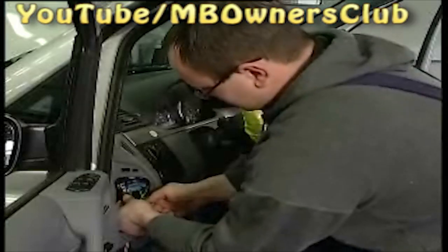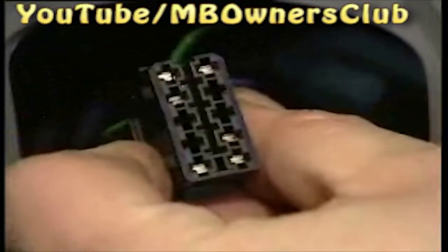In the footwell, connect the cable to the receptor part of the antenna. Next, the green cable is plugged into the switch of the stationary heating, namely in pin number 4. With the new cable, you can contact the switch again from the back.